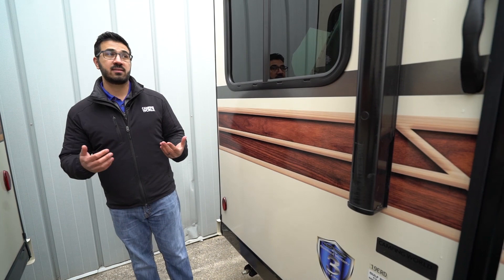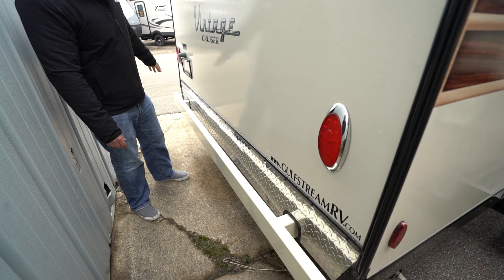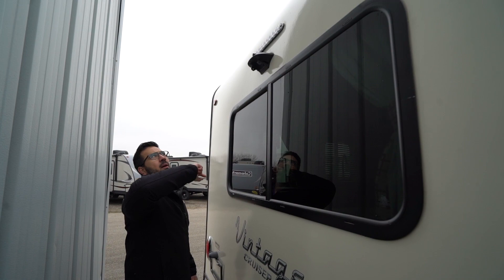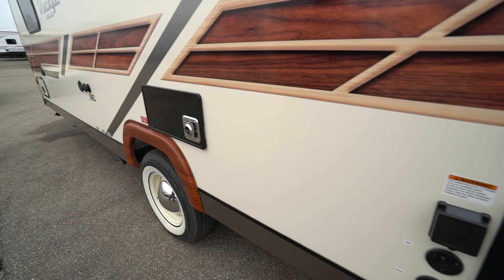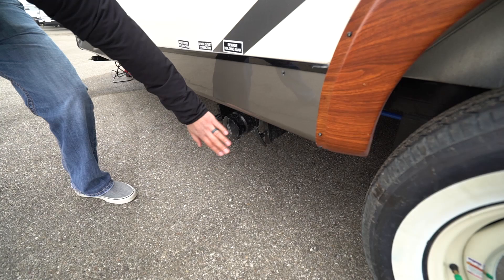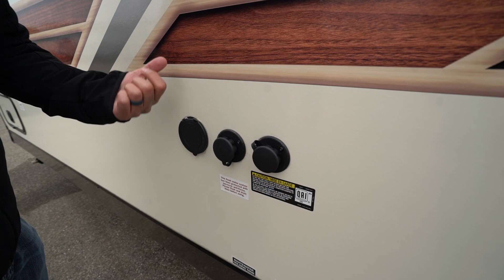Coming around to the back — as mentioned, there's no square tubular bumper but you do still have a bumper in case you back into a stump. Diamond plating down there as well, mainly for aesthetics. Right up top is your backup camera prep — having the prep makes installation easier and saves you money on labor. There's the same one-piece fiberglass coming around. On the off-campsite side you have a 30-amp detachable power cord, cable inlet, satellite inlet, termination drop, and your gray and black tank valves. Also important: a black tank flush — great to have on a smaller travel trailer. Just hook a hose up right there and it washes everything out. City water inlet, spray port for outside water access, and fresh tank fill are all located right there.